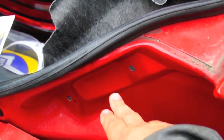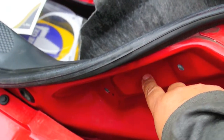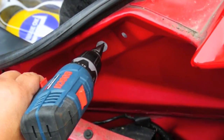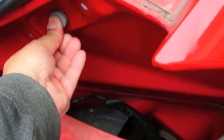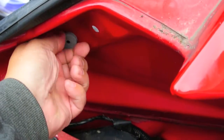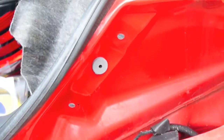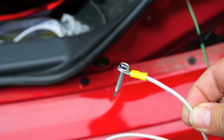I'm going to run the wiring for the new light right in here, so I've got to drill a three-quarter inch hole right here. We now have a nice three-quarter inch hole drilled with a step drill. The next step is to take the grommet and fit it in there until it snaps — there's the grommet. Then we're going to feed our wires through there, and also feed a ground wire through there. We've prepared the end of the ground wire with a self-tapping screw that we're going to screw into the chassis so that we have continuity to ground.